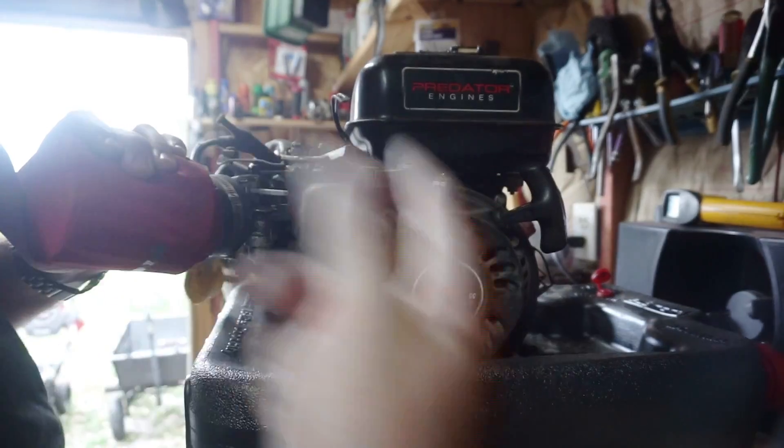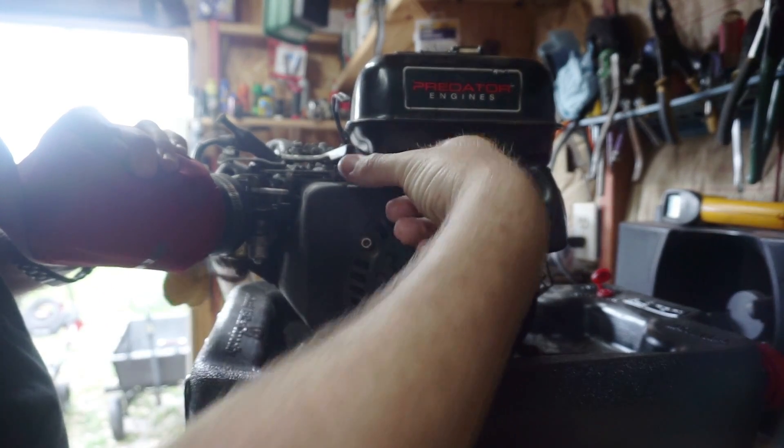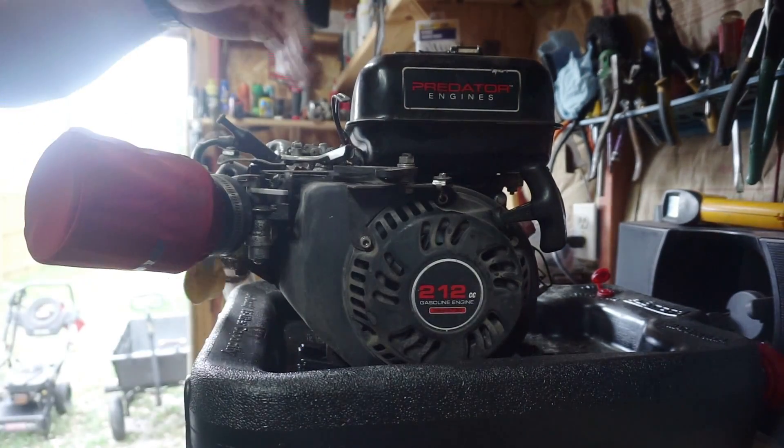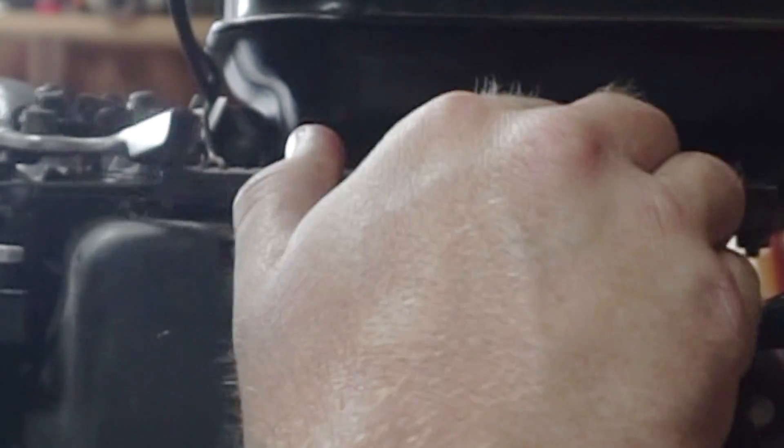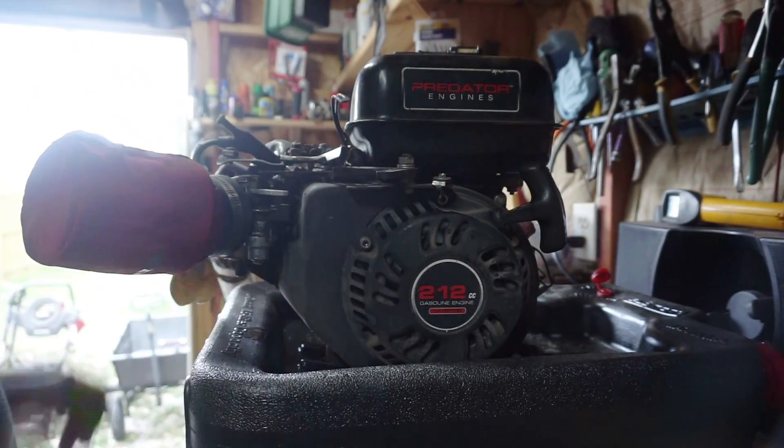It's just time to clean this thing up, overhaul it, and I want to delete the governor. As this thing spins at higher RPM, there's a little arm in here that coordinates with inside the engine and cuts power on you. It's somewhat bypassed by this linkage I've put on that holds the throttle hard open, but you still fight the governor — so that's one thing I want to take care of while I'm in there.